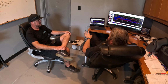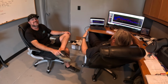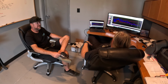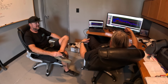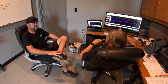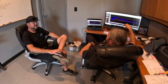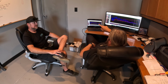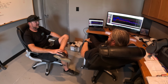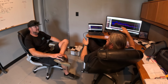I'm fairly confident that it's fat. But I will say that with the qualification: if it melts. Hemis are weird, not so much in what they demand, but in how the O2 sees it, because they short circuit so much and there's so much pulsing. Every Hemi I've ever done, the O2 is funky. You kind of got to take it with a grain of salt because there's a lot of oxygen getting blown through there, and that can skew your results.